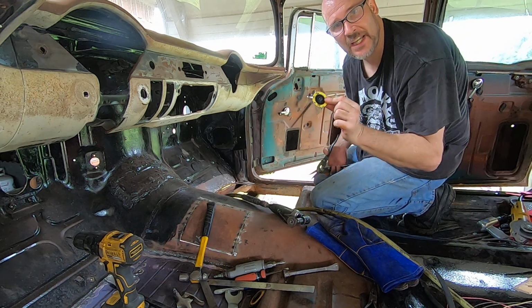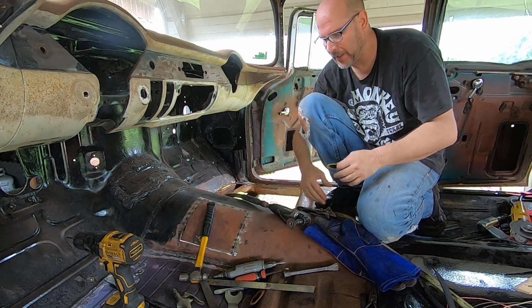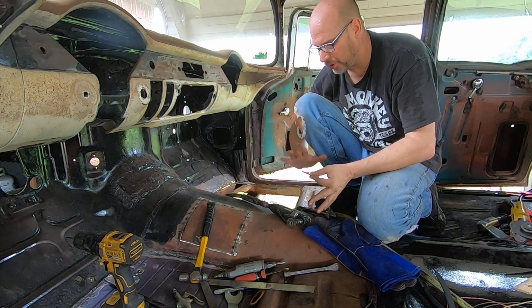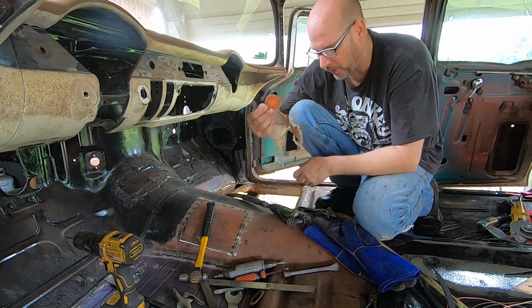The ones I use are Blaze. They're Norton Blaze, and they're 2-inch. The 3-inch, they always flex when you're going at pretty high RPM. They tend to do this stuff. I like the 2-inch. You can do a really nice grind with it. Everybody's different. I can tell you the green cores, these will outlast a green core like crazy.